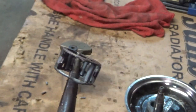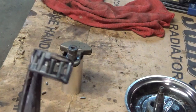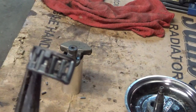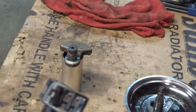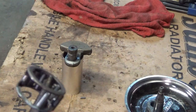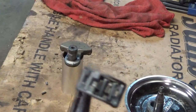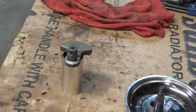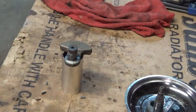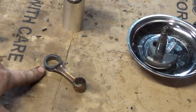That's what was wrong with this 576 XP non-autotune. The big end bearing, or the crank pin bearing, or the large rod journal bearing — there are different names depending on who you talk to. I just call it the large end bearing because it's definitely the large end of the rod. This is the one that goes on the crank.